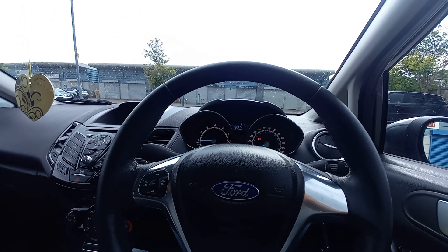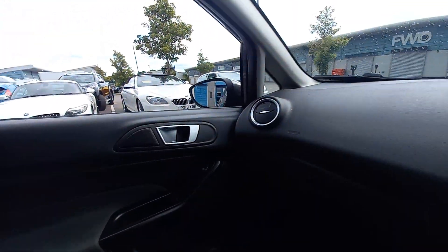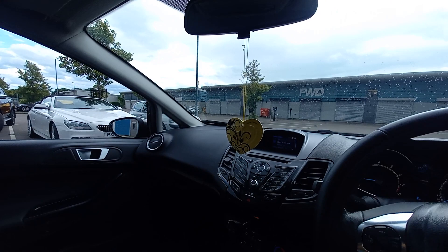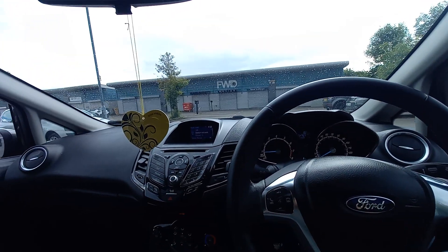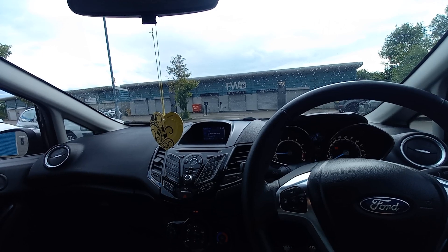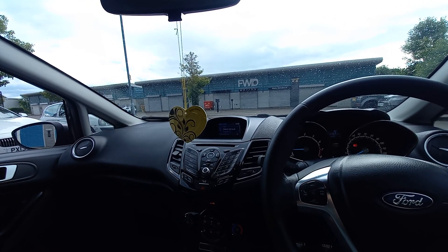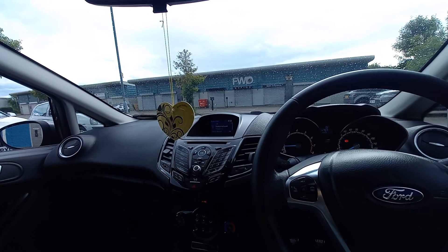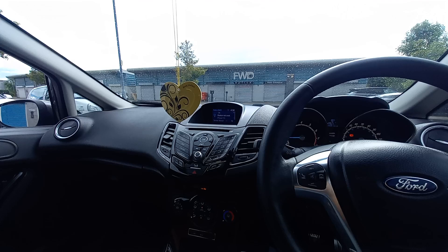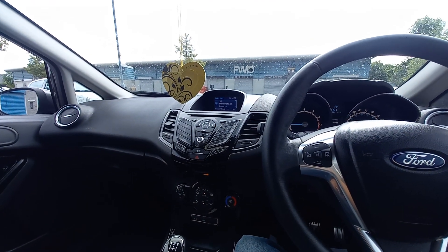What I find it even harder to believe — we've got a VW Golf over there, a 1-litre VW engine, also with a timing belt that has a lifetime guarantee, meaning it's changed every 15 years or 180,000 miles. So VW have gone one step ahead with 15 years, while Ford is 10 years and 150,000 miles.